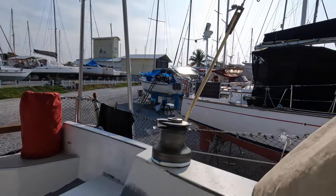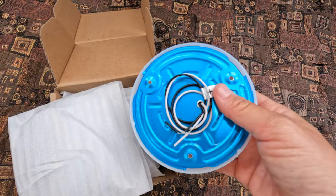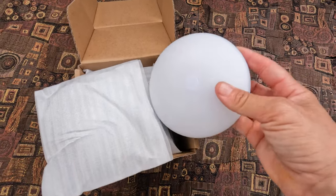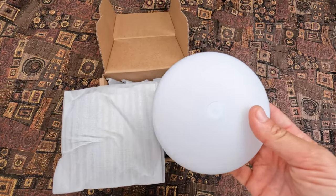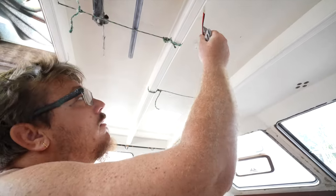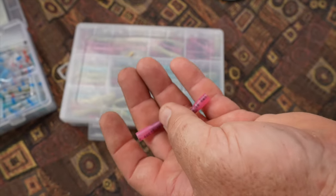Our neighbors returned and brought us from the US some new 12-volt LED RV lights that patrons of ours had bought for us originally, but now these are the replacement. Easy switch on and off, 12-volt, they consume nothing. The only drawback we found with these lights is that they didn't all survive the lightning strike. Cut the old crimps off and re-crimp the new light onto the wire, then just literally use the same holes and boom, done. We bought the same lights we used to have because it would be super simple to get them working again — basically just plug and play. Well, connect, heat shrink, and then play.